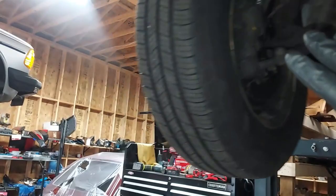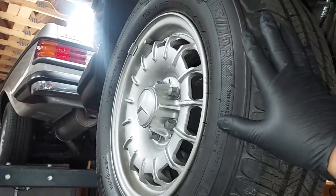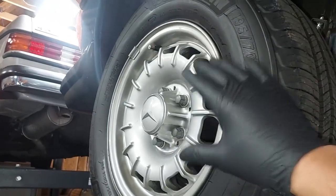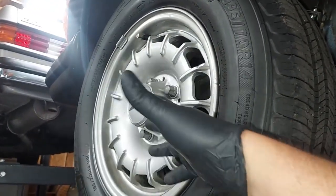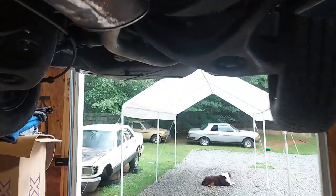You can still see factory markings on these brakes and they work fantastic — no reason to change anything else. I also removed the wheels and put in new bearing seals and repacked the bearings because they just had the original grease in them, so that's been taken care of.